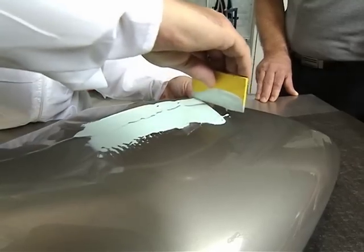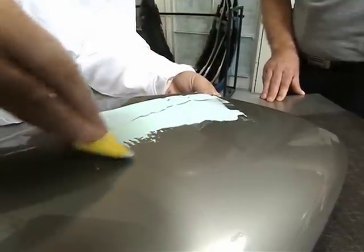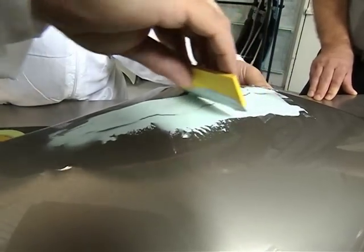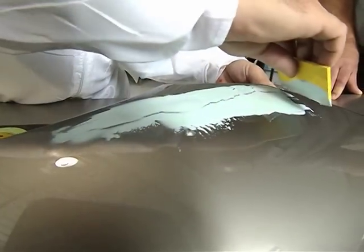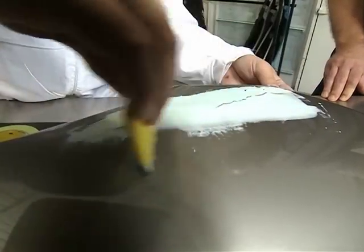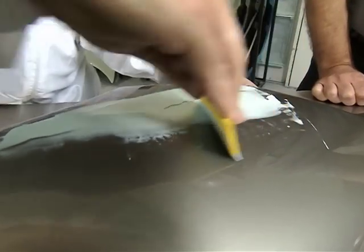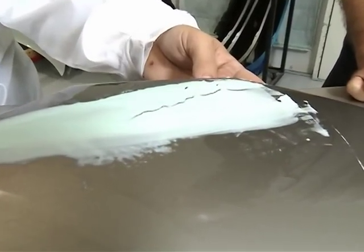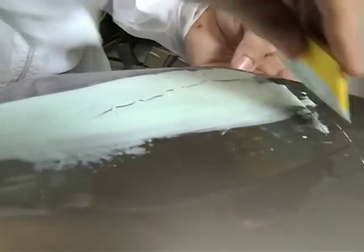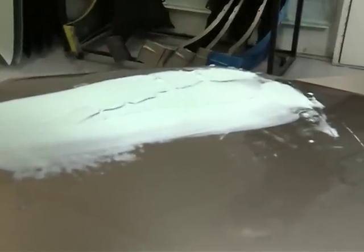I notice that run really stands out when you put that stuff on — it certainly does, it makes it look even a little bit worse. The key when applying the glazing putty is that you do try to taper your edges off a little bit, so you don't have excessive sanding. You're trying to eliminate a run, but if you've got a lot of sanding to do in the glazing putty, that defeats the whole purpose. The clear coat has to be thoroughly cured to do this — fresh out of a forced dry cycle, out of the spray booth, we can't expect to do this. Sometimes that means putting a heat lamp on it for a few extra minutes, about 15 to 30 minutes depending upon the product, temperature, and humidity.